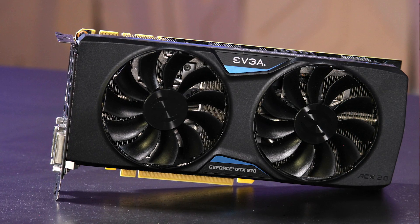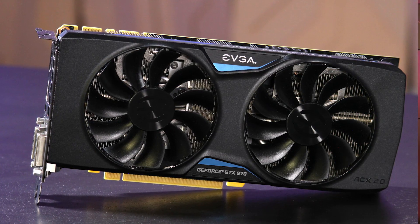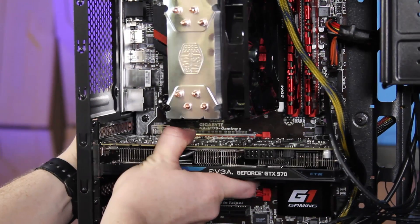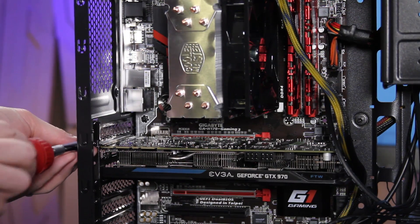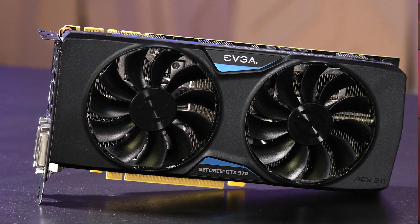Probably the next most important part is going to be the GPU. And it's by far the most expensive part in the build. We went with the EVGA GTX 970 SuperClocked — that just means it runs at slightly higher clock speeds out of the box. It's using a custom cooler, so it's going to be a little bit quieter, but it's got the HDMI connection you need, plus DisplayPort and DVI for other monitors. It is $309, the most expensive part. Four gigs of memory on it, 145-watt TDP. Virtual reality is so graphically intensive — this really is the floor. Once you lose frame rate in virtual reality, whether you're using the Vive or the Rift, you get physically ill. It's not okay to run this at a lower frame rate. If you're going to skimp on any part because you only have $750 or $800, the GPU is not where to do that.